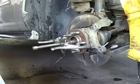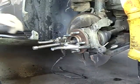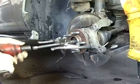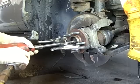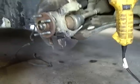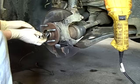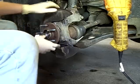Okay, got my puller on there. I'm going to remove the spindle. As I tighten this down, it'll pull on the bearing assembly, pull this whole thing out this way. Alright, pull it free. Washer off.